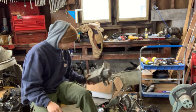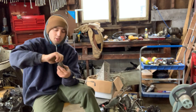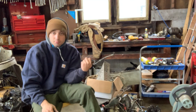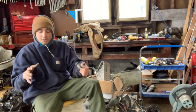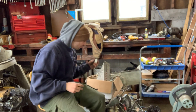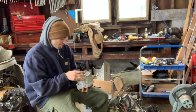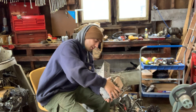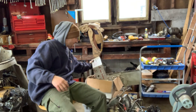This looks like a really well-made catch can — probably for both valve covers, with two lines going in and a petcock on the bottom to empty it. It's got a breather cap so it wasn't holding pressure. Here's what I was talking about — the inline brake bias fluid interrupter. As you turn this knob it adjusts the fluid pressure from front to rear. So this car had a dual-adjustable brake system: the balance bar on the dash and this brake bias adjuster inline. I also got a couple of alternators — they're probably bad. They both look like Delco Remy units.